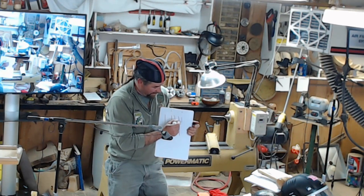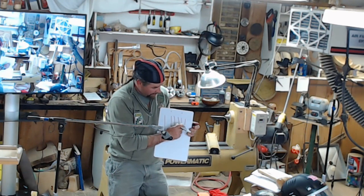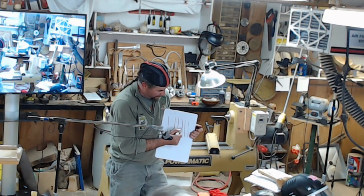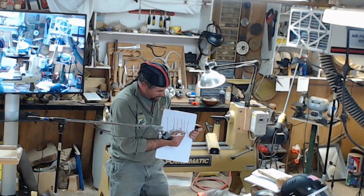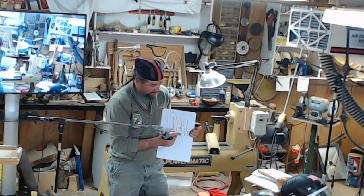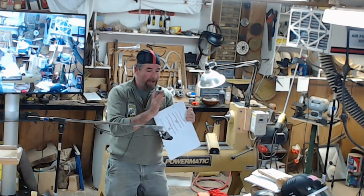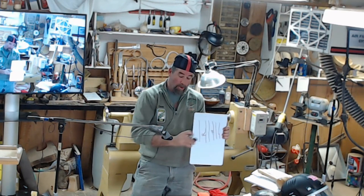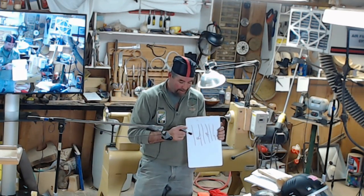But the one they're recommending now is an open face notch, where you're going to have almost a 70 degree angle with less of a notch, less depth. You're going to start a lot bigger and come all the way, almost like that. The purpose of that notch is, you've all probably made smaller notches, and as soon as that notch closes up, that tree has a tendency of barber chairing, or kicking back off the stump.